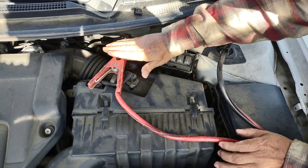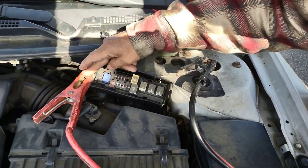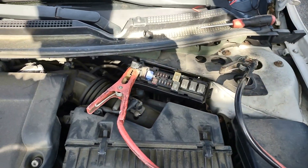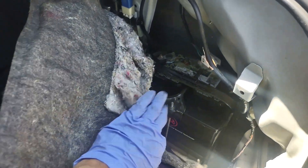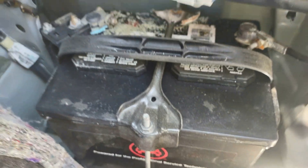The 12-volt battery needs to be replaced here. If you let that 12-volt battery go, you won't be able to open the trunk. But this is how you can jump it. That's the 12-volt battery right there, just in the corner here — very easy to replace.